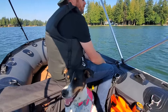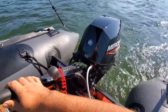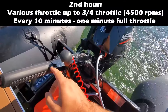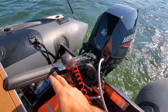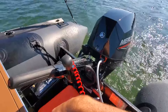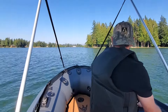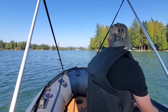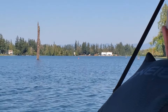The time has come — coming up on the second hour. On the second hour, we're going to be varying the throttle as we did before, but we're going to be taking it up to three-quarter throttle, varying it from idle to three-quarter. And then every 10 minutes, the manual said to go full throttle for a minute, which my buddy and I are not too excited about because we're happy at half throttle, man. This thing moves. So we got a little straightaway with the least amount of waves — we're going to see what happens.